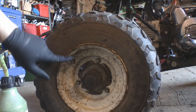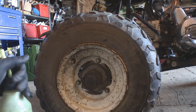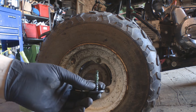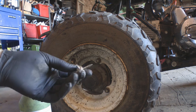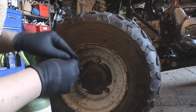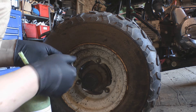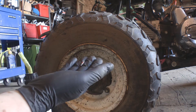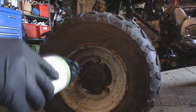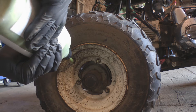The first thing you want to do is make sure your tire valve is just above the halfway point — about three quarters up — then pull the cap off. The cap actually comes with a tool to remove the valve, but I've got one anyway. Just unscrew the valve. I've got gloves on because this stuff can be quite messy. So that's the valve out, and then you basically stick the bottle in and squeeze until the required amount is in there.